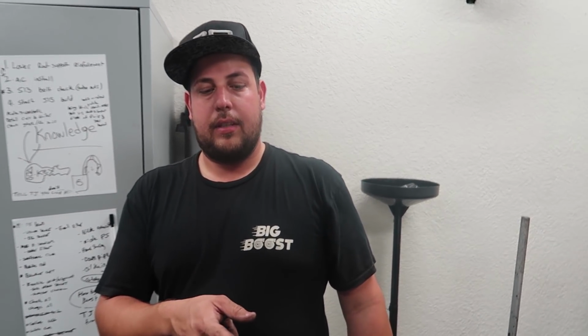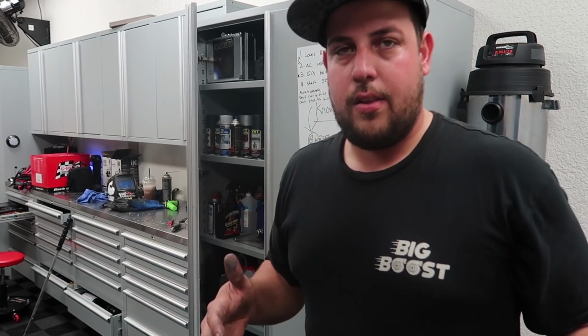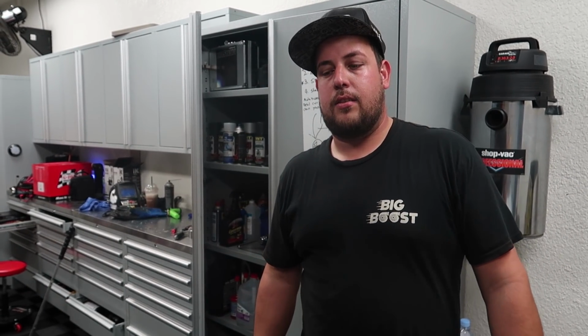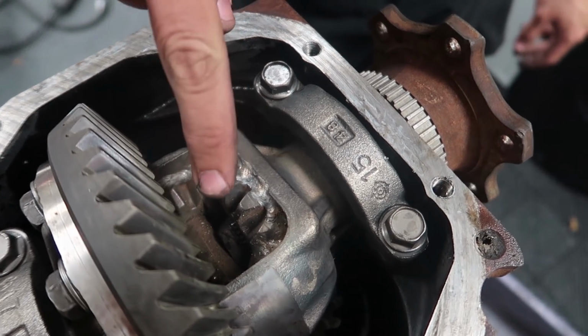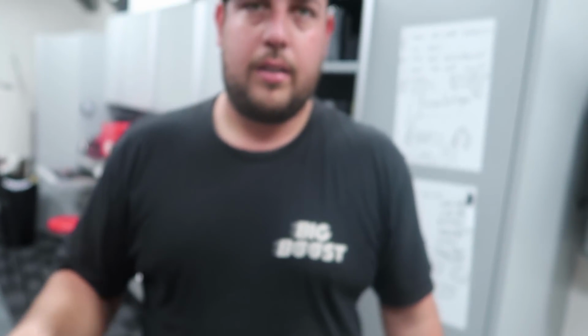For the power level, it's okay to weld 4 corners, so all the planetary gears together. But I welded it for high power in case whoever gets the car decides to upgrade it, and it will hold turbo power. I welded the planetary gears together and also the planetary gears to the housing as well, so it's welded everywhere. So it's completely reinforced all the way around.